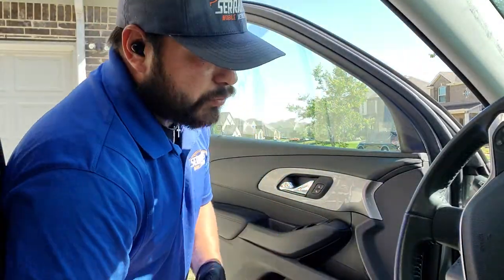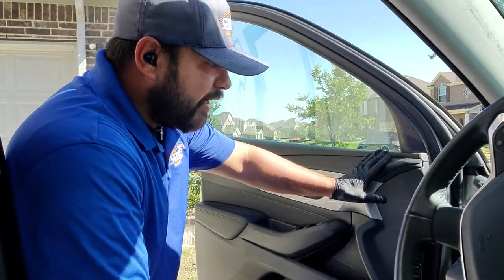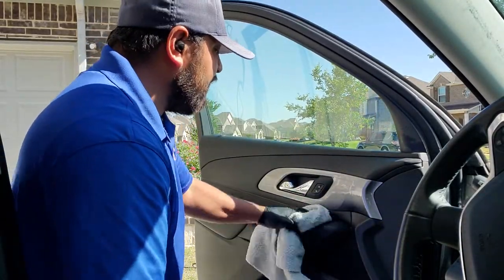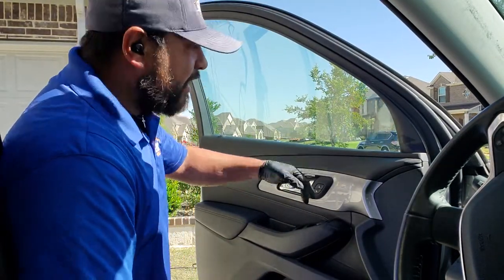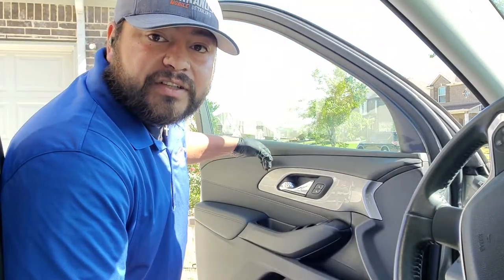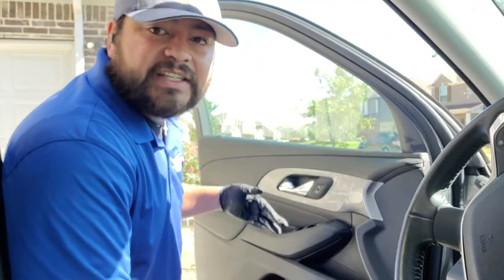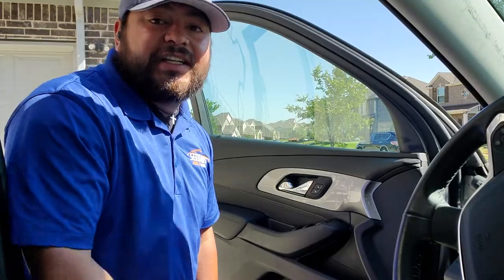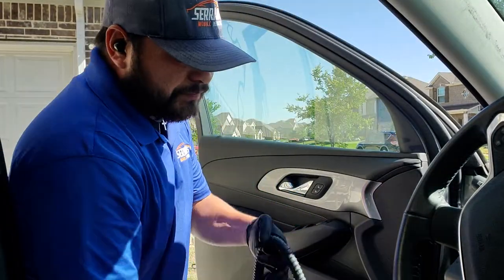That's pretty much how I do door panels. I know many like to — if the door is clean — use a towel, spray it on the towel, and wipe it off. But I like to use the steamer and the Vortex air tool because it literally gets everything. Some just steam and wipe, but for me that can leave water embedded in the crevices, so I always steam, wipe, and vortex — that way with the air I get everything out really well. The tools used today are the Serrano sauce, the Harbor Freight steamer, and a Vortex air tool. You guys have a blessed day and thank you for watching.